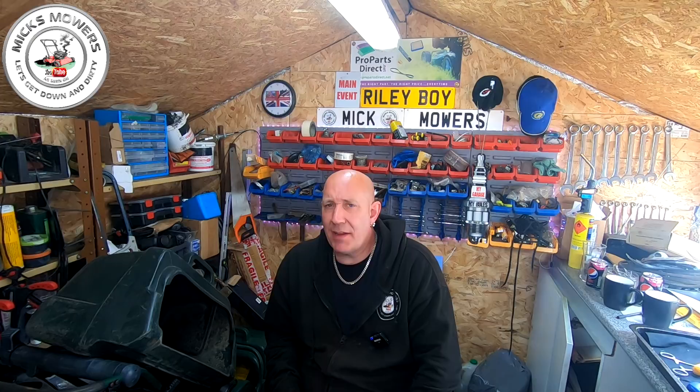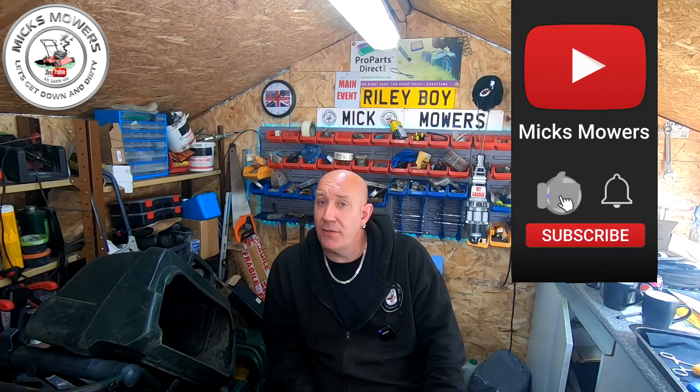Okay so that little Honda lawnmower is now all up and running. I would say I'm 99.9% happy with it. I think it needs a new carby - that's the truth of the matter. It runs beautifully and it idles, just not as well as a Honda should. Those little tiny Hondas are governed with a little tiny mixture screw - you can take them off, but for what it costs, another carburettor is cheap enough to just buy new. I might suggest to run it and see how it goes, then come back if there's any problems. But it starts, fires up, cuts grass and drives. It now cuts faster as well because the revs weren't as high as they should have been. Hopefully Luke will be super happy - he's on holiday and when he comes back he'll have his lawnmower good to go. If you liked this video, don't forget to hit the subscribe button and the bell for notifications. I also do a weekly live stream Saturday nights at 6:30pm UK time. Until then, take it easy.